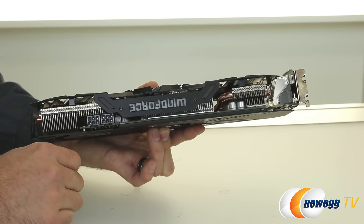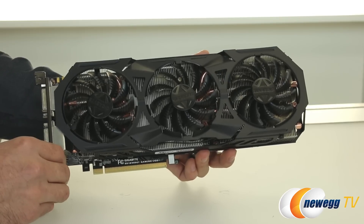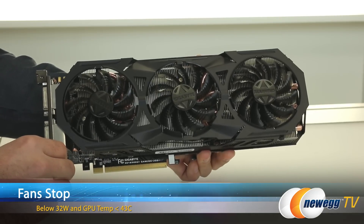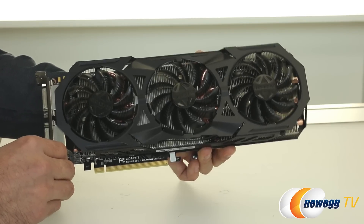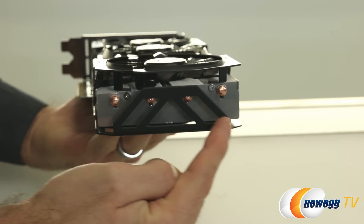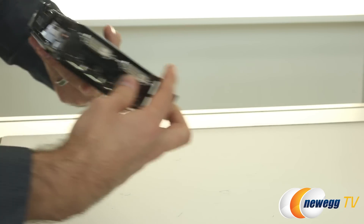If the light is off and the fans aren't spinning, you have a problem, and you can contact Gigabyte for support. They're also including a fan stop mode — a new fan curve where the fans spin when GPU power is above 60 watts or GPU temp is over 62°C, and the fans stop when GPU power is under 32 watts and GPU temp is below 43°C. Both conditions must be met for the fans to stop, at which point the card runs in passive mode. Four 6mm pure copper heat pipes do all the cooling passively via direct heat pipe touch, helping dissipate heat more efficiently.